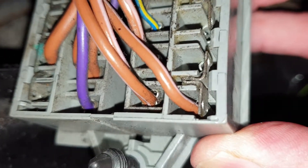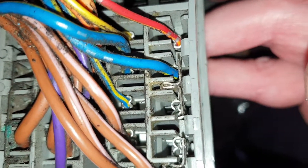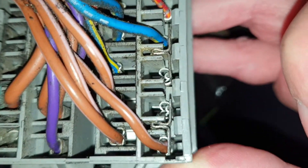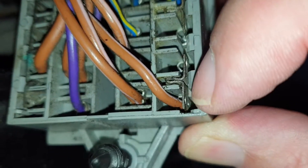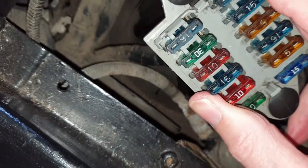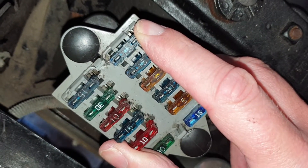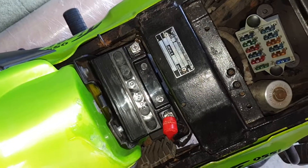As you can see, it's not a standard spade connector. The wires get pushed in and must be secured with a special tool that bends little braces in. So I got in there with my screwdriver and tightened up those little braces, pinching the connectors a bit tighter. I retested this side of the fuse with the bike running and, lo and behold, the voltage jumped back up to 14.2. And then testing positive to negative on the battery, my voltage was back up to 14.2 as well.